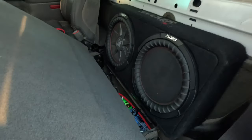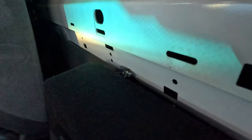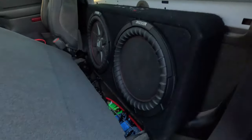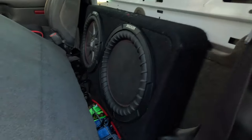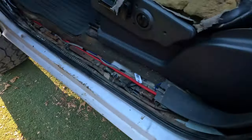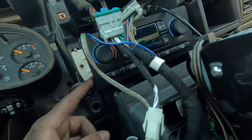The subs are here. I had to take this panel off. My negative — I just sanded down the paint for the amp ground and put the ground wire, the black wire coming off the amp, to the cab of the truck. I took all the trim off, ran it down through there, and I ran my head unit wires up through this little gap here. It's kind of hard to explain since I put some stuff back.